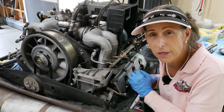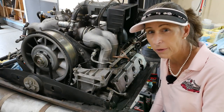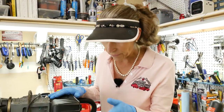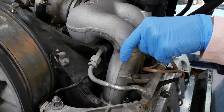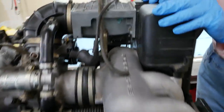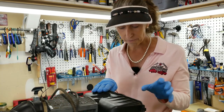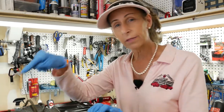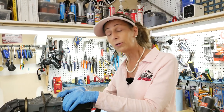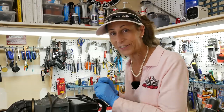You can only take so many pictures, but if you've got it off you can turn it upside down and take more pictures, which is really helpful when putting it back together. There's really not that much holding it on — two bolts, one on each intake plenum. They're 8mm cap bolts, and we have some brackets on the other side to remove as well. There's a big plastic bit from the air box that needs to come off first because I can't get to the bolts underneath it. I'll get the brackets, take those cap bolts off, then ask my assistant Heidi to help lift it straight up onto the workbench.